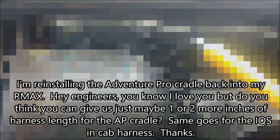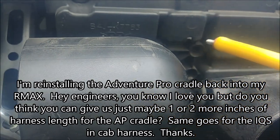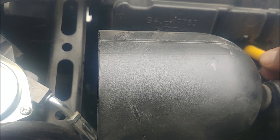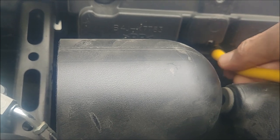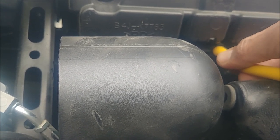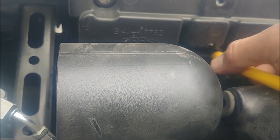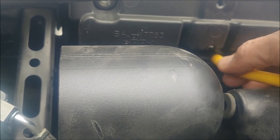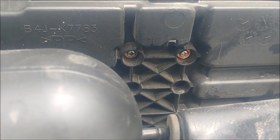When reinstalling these screws, get a piece of silicone hose, put your screw on it, thread it in by hand, then pull the hose off and finish up with a screwdriver. I've lost three of these screws now and this is the best solution I've found.